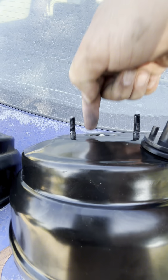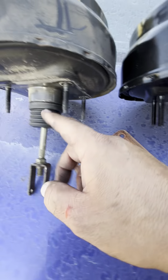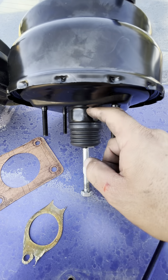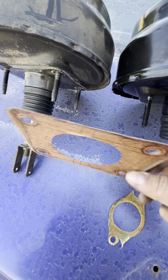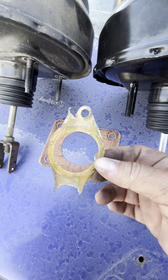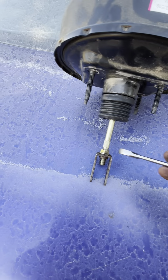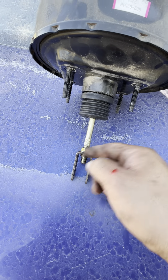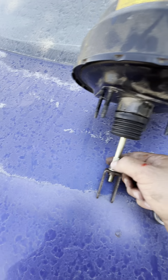We're going to have to remove this and put it on the new one. Basically, take a measuring tape and measure from here to here, and you'll be able to match that exact specification on your new one. In a perfect world, either get a new one of these or try to reuse the one that's on there. It's a small detail even I forgot about. It's a 14 millimeter — not too hard. Just grab a pair of channel locks or a vice to grab this, and it just comes loose. Then you'll be able to undo this one and put it on the new one.